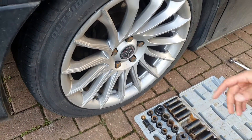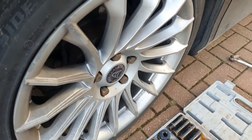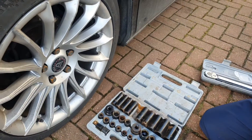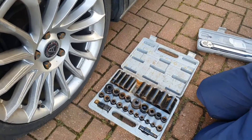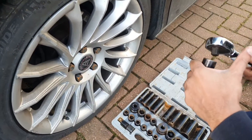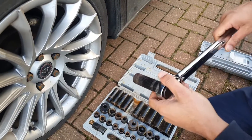When using impact drivers, bear in mind there's a lot of power going through them, so you want to use them on bolts of good quality and size. Impact drivers will tell you in their instructions what size of bolts you can use them on. You don't want to use them on small bolts, because all that will happen is you'll possibly shear the bolt right off — and that's just going to be a disaster.